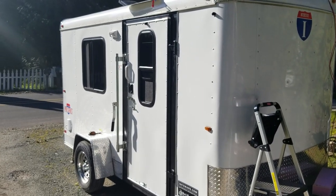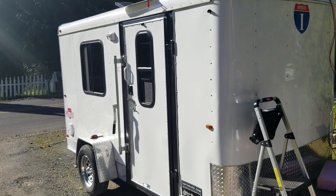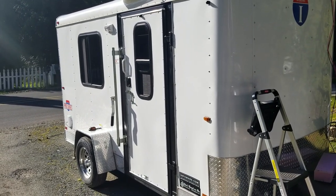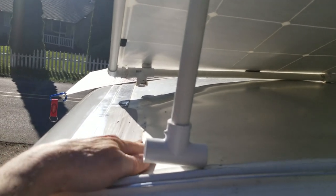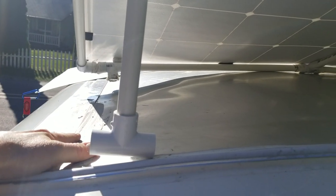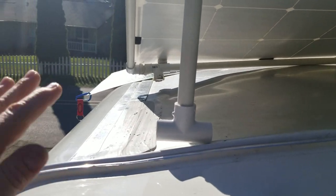Really cool setup. We took a cargo trailer from Interstate Trailers Plus, a Pro Series. There are three things you want to look for in a cargo trailer. Number one: aluminum one-piece roof. That's important — make sure you have a roof that's going to last a long time. It's one-piece aluminum all the way across, screwed in and taped over so you don't have to worry about leaking. It's also rounded so the rain runs off, and it's got cool lights up top.